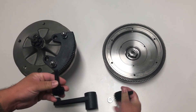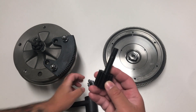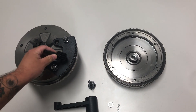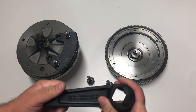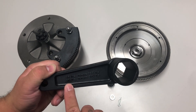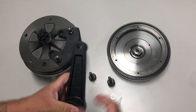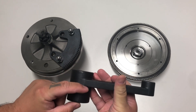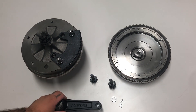The gears they give you — the small one is for 6-volt flywheels only. The large one is gonna work on 12-volt flywheels and on the brake plate. 25 foot-pounds at the small nut will give you 225 foot-pounds at the large nut. 30 foot-pounds at the small nut gives you 270 foot-pounds at the large nut. It also has two different sides depending on what you're doing — tall side is for flywheels, short side is for brakes, and I'll show you how to assemble that now.